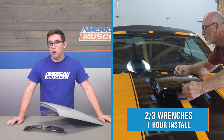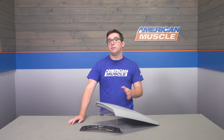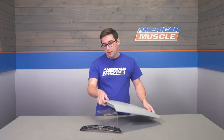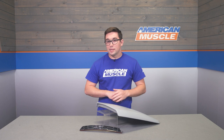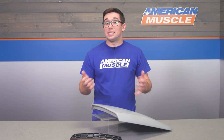Installation gets a 2 out of 3 on our difficulty meter and should only take about an hour to complete. That does bake in a little extra time assuming you're going to paint or finish it off yourself, but actually getting it mounted on the car is very straightforward. You're going to peel and stick the tape, get the scoop into place, and use the included template with the two screws to mount it securely. Make sure you get your hood nice and clean before you start, and consider finishing off those drilled holes as well. Also a good idea to do this in sunlight so the adhesive is a bit warm to ensure the best stick. But enough of me talking — let's hand things over to one of our AM customers who's going to walk you through the process.